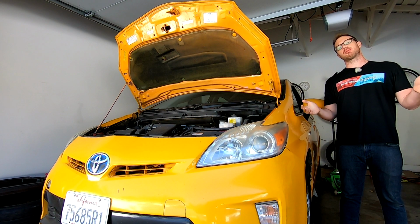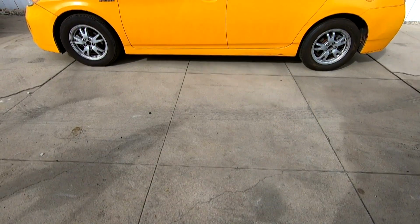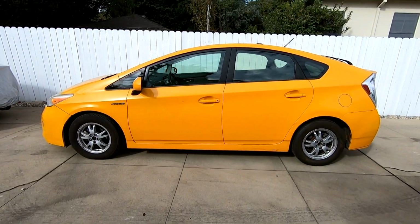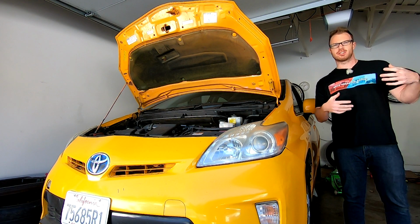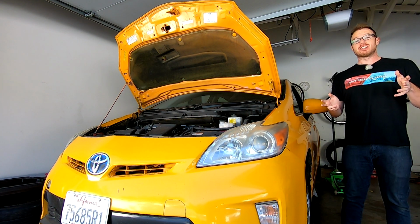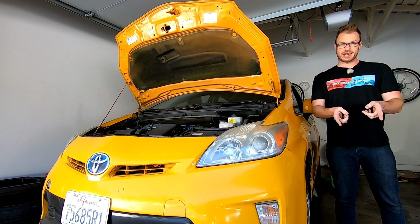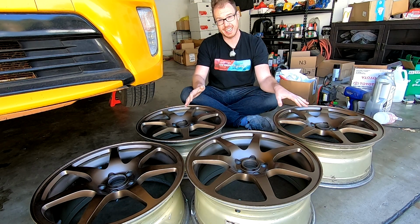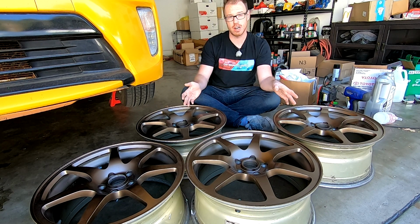As usual, when it comes to wheels, I went a little bit overboard on Facebook Marketplace. You see, the Prius has a 5x100 wheel bolt pattern, which is pretty commonly found on smaller Japanese cars like smaller Toyotas, Subarus, etc. I eventually found these wheels right here for an absolute bargain. Check it out. These are a set of Rota SDR wheels, size 17 by 7.5 with a plus 48 offset.